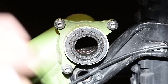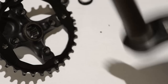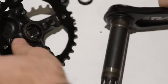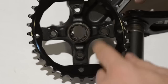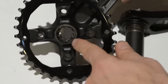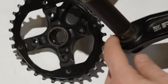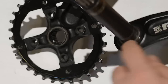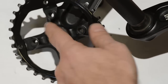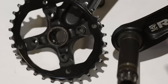I'm going to just wipe it clean. With all the bits and pieces cleaned up — you can see them here — this is my axle and the drive side crank arm. Pay special attention to these areas here, and also make sure you apply a bit of good quality waterproof grease. Same thing here — make sure you clean it thoroughly and apply a bit of grease. There is a rubbery edge on both sides here that would provide a bit of a seal between this and the bottom bracket cups.